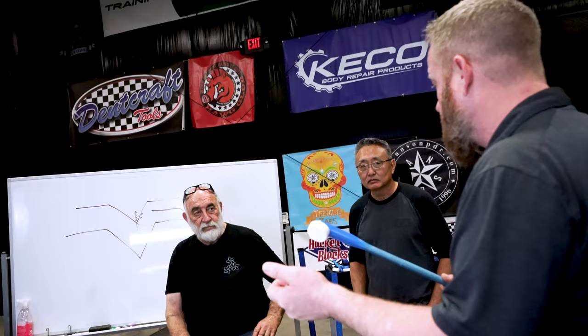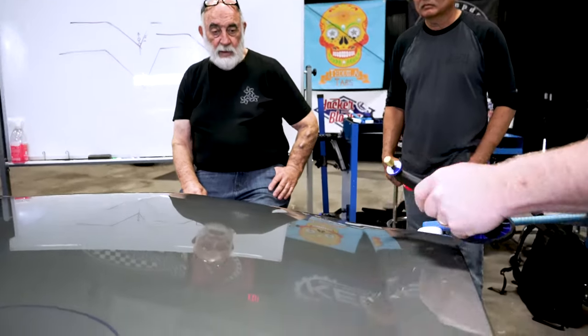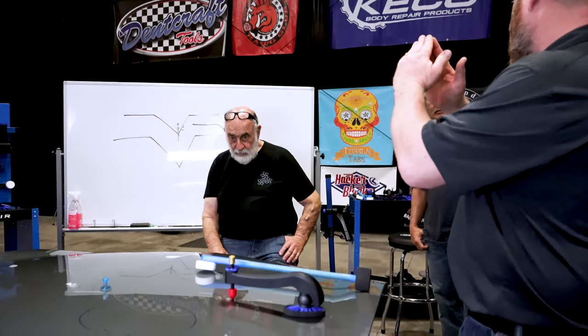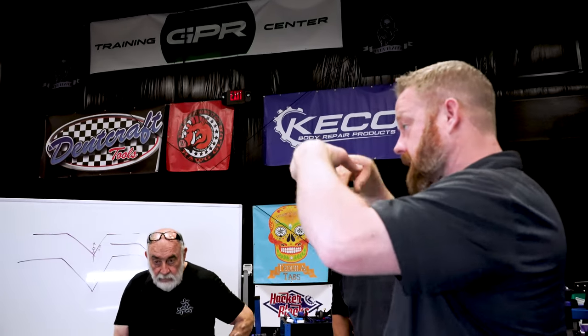Same thing like we gently increased our aggression with the pull. We're going to increase our aggression with this. What we don't want to do is come right in and put another thing. Like, you're going to hurt things with that. We're going to use our light. We're going to look for that light to dark high spot or light to dark transition, just like we had in the low, right? The low is a high spot on the other side. The high spot's a low on the other side.